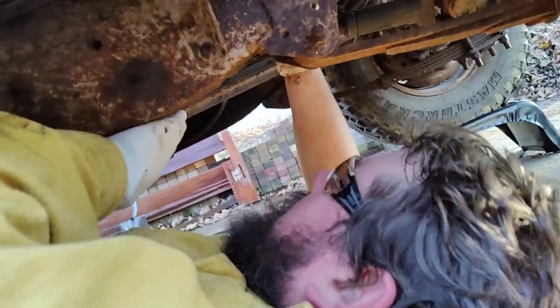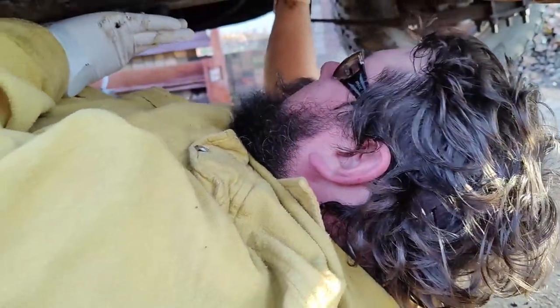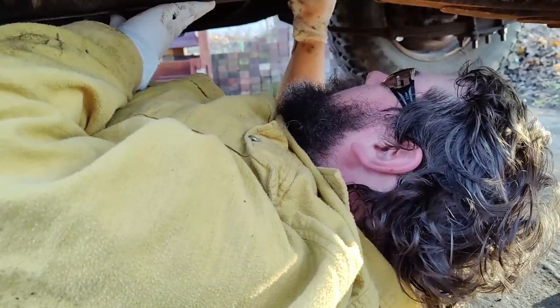How do you think this happened? I have a feeling water got in somewhere - one thing didn't seal and water got in it somehow. When it was full and the seal the leak seal worked, it froze and blew the seals out. I can't tell for sure where it's all leaking from, but I think it's leaking here at the fill and from the pan. It may also be leaking from the return line for the transmission cooler.